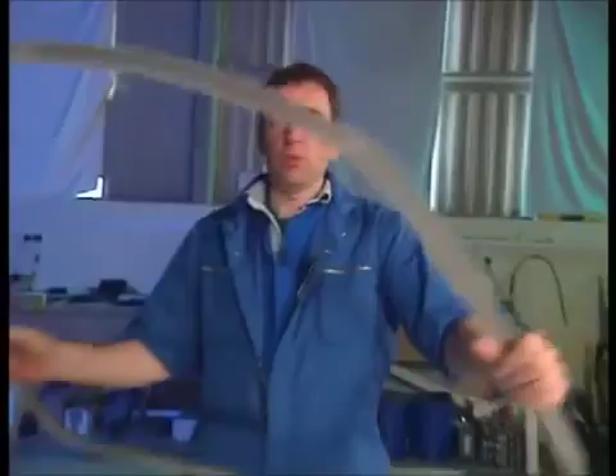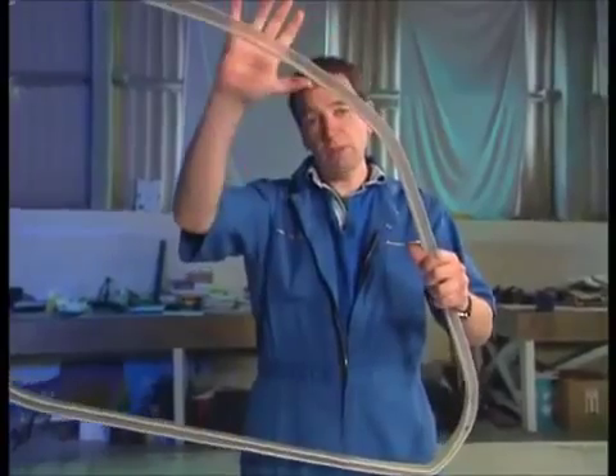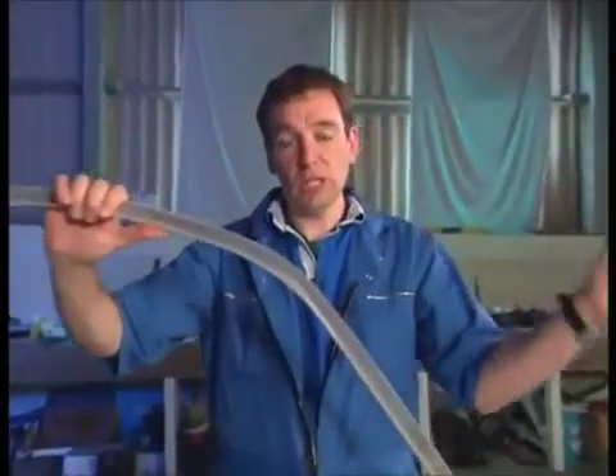Doors. You need doors on your helicopter for three very important reasons. The first is to keep you nice and warm in inclement weather. The second is to stop your papers blowing around when you're flying at high speed and rolling and banking all over the place. And the third is just in case your safety belts fail — you won't fall out. So they are important, although a lot of people in the States fly without them because they get a breeze and it's very nice. But in this country we're going to put doors on. The doors come in a few bits: the frame, a piece of plexiglass that you have to fit and shape to the frame, and then all the bits for the hinges to attach it to the aircraft.